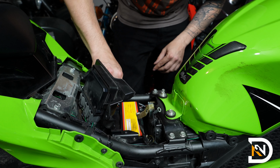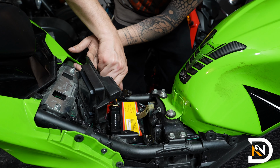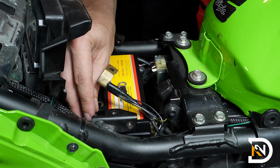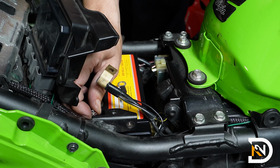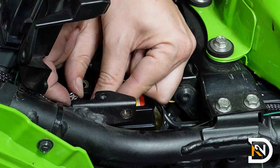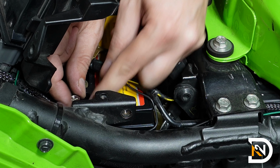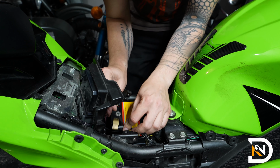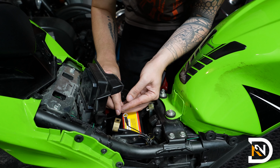And from this point on, it's very easy to catch on. And we'll do the same thing on the negative terminal. Got the nut in there, we'll attach the screw. Turn it just barely enough to catch the thread. That allows you to lift up the nut. And now we can add a piece of cardboard underneath it as we lift it up. Lift up the screw, slide the cardboard in, and now we can attach the terminal and any other accessories you might have here.